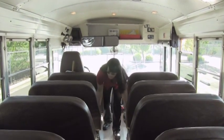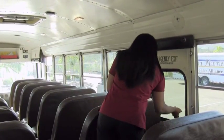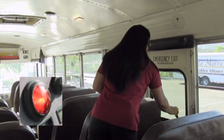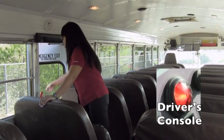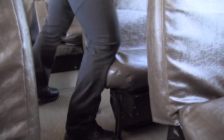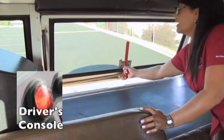Checking the floors to be clean, checking the seat backs and seat bottoms to be secure, and the rivets and panels to be secure with no missing screws. At the emergency exit, just lift up the red handle, push out — I have an audio and a visual. This emergency exit you open by picking up the red lever — I have an audio and a visual. Continue back, check in your chairs, checking for any obstructions at the front and the rear of the heater. You have an emergency exit and instructions that are clean and legible — lift the red lever, you have an audio and a visual.